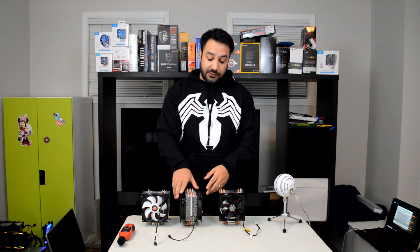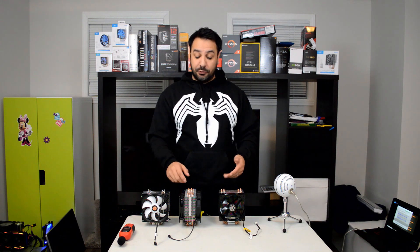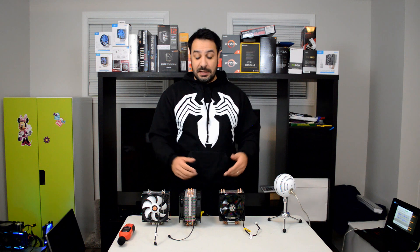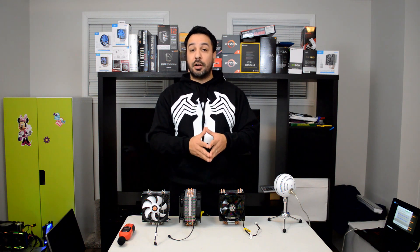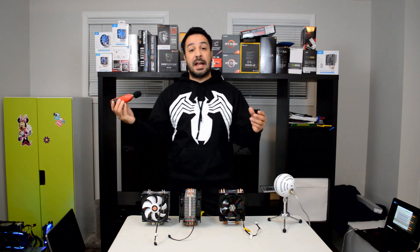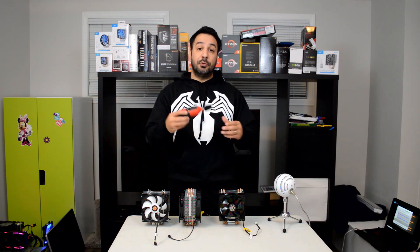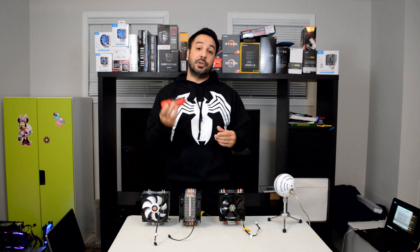Just to explain how I went about testing: I used the exact same 120mm fan that I attached to each one of these coolers individually. I ran the tests with one fan and then with two fans and looked at the results. Did we get better performance? How was the noise from the second fan? For that testing I used my test bench, which is a Ryzen 3 1200 overclocked to 3.9 GHz using 1.3 volts. For the sound testing, I used my portable sound meter, placed about a foot and a half away — roughly equivalent to someone who games with their desktop tower on their desk, to give a real-life scenario of what noise to expect.